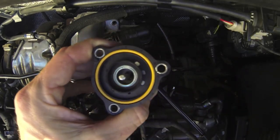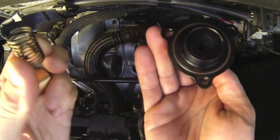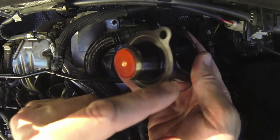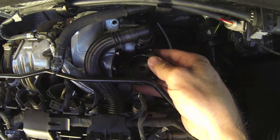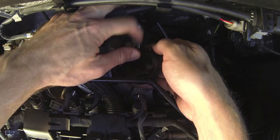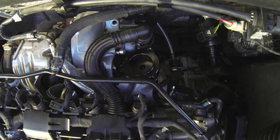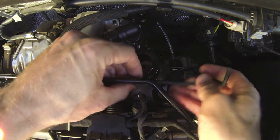So that's the DV Plus valve body. It comes with the main spring and piston. The O-ring is already installed on here, so you just need to put that straight back in place of the factory diverter valve. You can use the same screws or the screws included in the kit — they're the same size. Now you must put the valve body on first before you mount the solenoid onto the DV Plus, because you can't access this screw once the solenoid's on. So again, take care not to drop these screws.